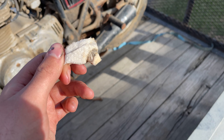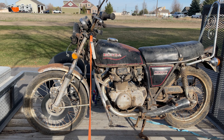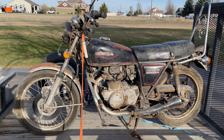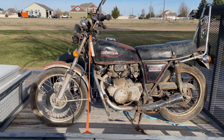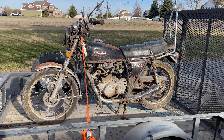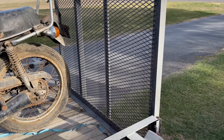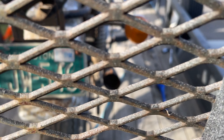There's no kick lever on the other side, so we couldn't really kick it over to see if the engine spun. But I did put it in sixth gear — the 360s have six gears — and put some Marvel Mystery Oil, just filled the plug holes up with Marvel. The spark plug caps are really good at keeping water and debris out. So that is the first concern: will the engine work?